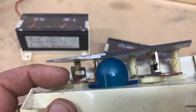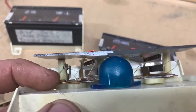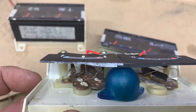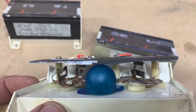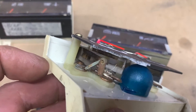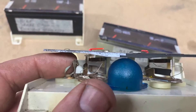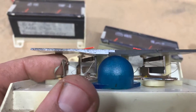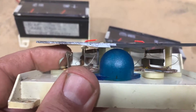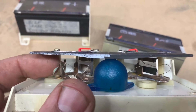Or worst case scenario, it might even start a small dash fire. So it's probably a good idea to get in there, cut that piece, and then buy yourself one of the commercially available electronic regulators. The difference with the electronic regulators is that they're a lot more reliable — they don't rely on this mechanical opening and closing happening endlessly the whole time you're driving to regulate the amount of power going to your gauges. It regulates power to your gauges electronically.